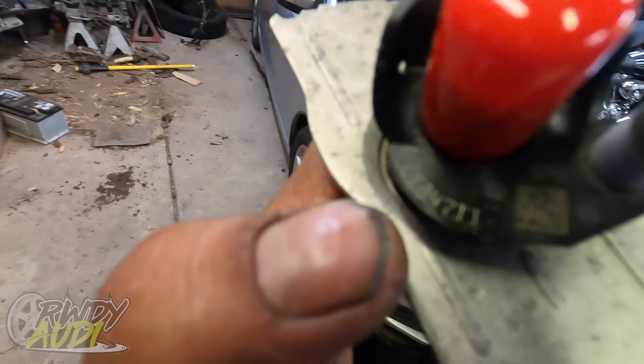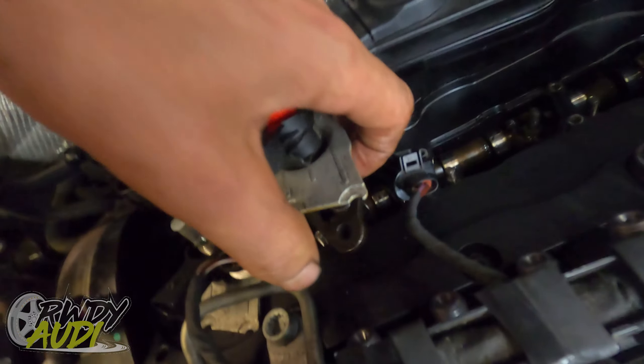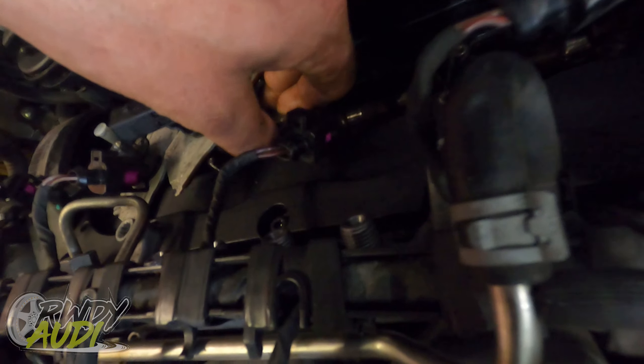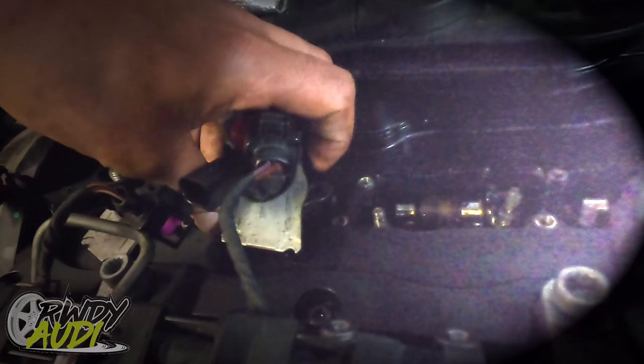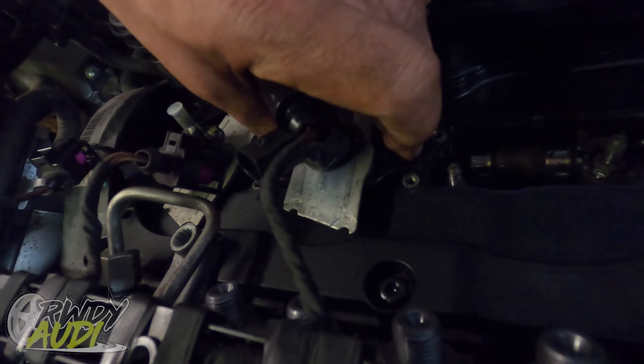Now's a great opportunity — make sure to take a picture of each one of your injectors. Figure out a way to label it in your phone or whatever device you're using, whether it's writing it down or whatever, and make sure you know where they're going. I've already got one in, it's pretty easy to get in there. So this goes down in there, and then your little band has got to be setting in the notch.